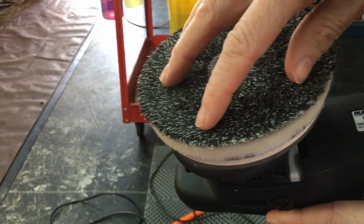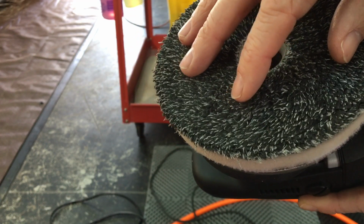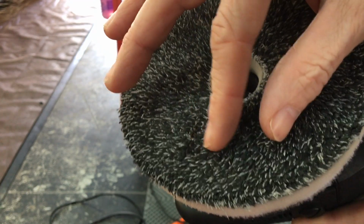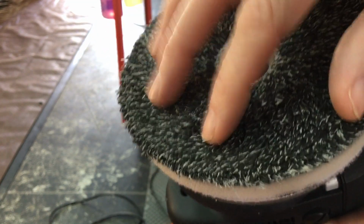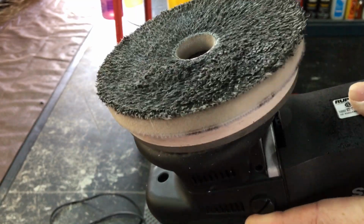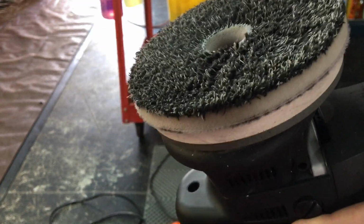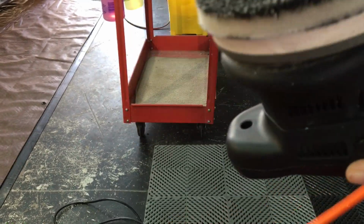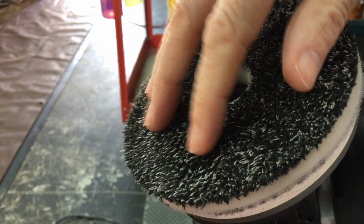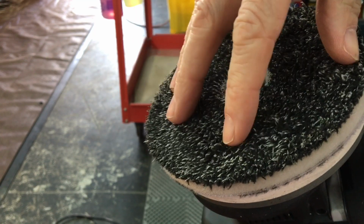The same also happens to apply to microfiber pads, and especially more important for this type of pad here, the Eurofiber 50/50, where you have half of the fibers that serve as cutting and the other half that serve as polishing fibers. And when they get matted with compounds and polishes, they bind together and then cannot work individually. So again, between every pass, clean them off. Have a dedicated pad cleaner, a brush, and if it's available, forced air. Now, as you can see, it's cleaned off. They're not matted together. Each fiber can work on its own. It will give you a consistent, safe cut.